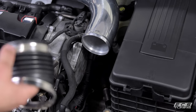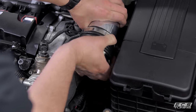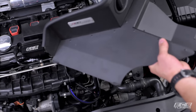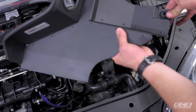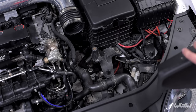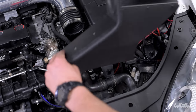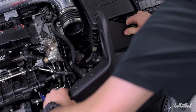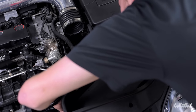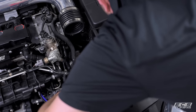Now we're going to install our flex coupler. I've already put two 70 to 90 millimeter hose clamps on it and I'm just going to slide it onto the upper intake tube. Next we're going to install the front heat shield. Install another grommet — like you would have found on your engine cover — into the tab, which will mount the heat shield on its post. You've got to get these tabs under the radiator shroud, so it requires installing it in a slightly tricky manner. You can get a little more room if you remove your battery box, but tuck it in and tip it down to find the right spot.